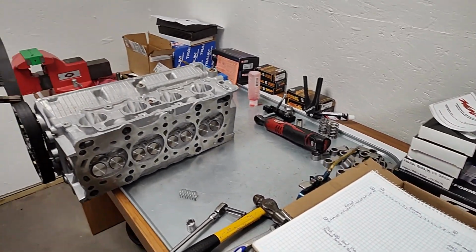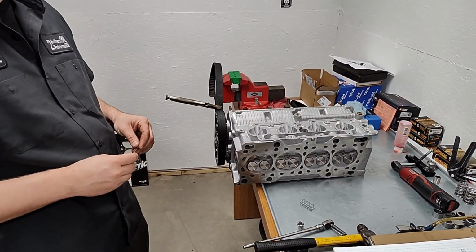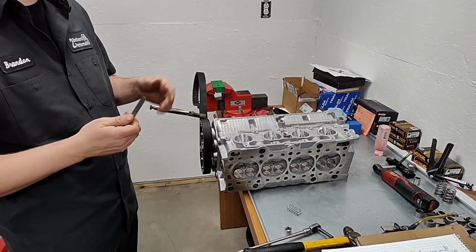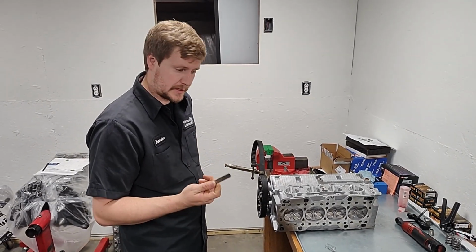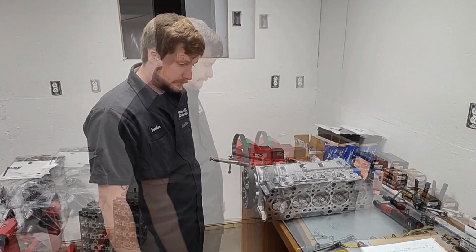So this isn't something you're eyeballing. You're actually taking a feeler gauge and you're measuring. Yep. Is there space? What would be the tightest limit that would be acceptable? Because valves, even though they're moving linearly, you do have a little bit of wobble in your guides and things like that, depending on how loose your stuff is. I typically go 35 thousandths. These things are spinning 10,000 RPMs, and with any kind of variation, I want to make sure I'm well in the safe zone.